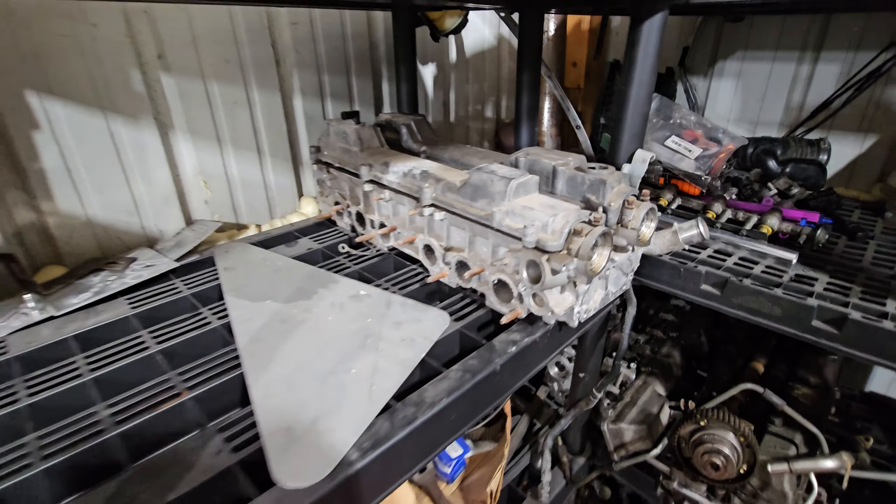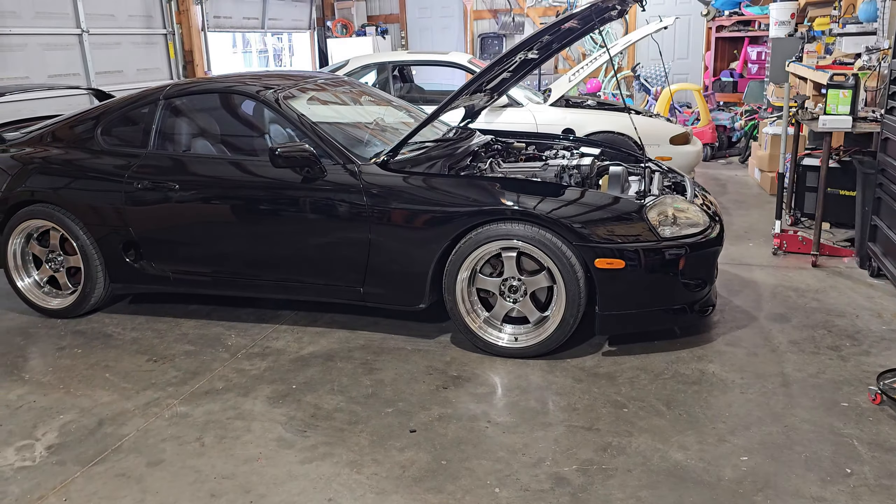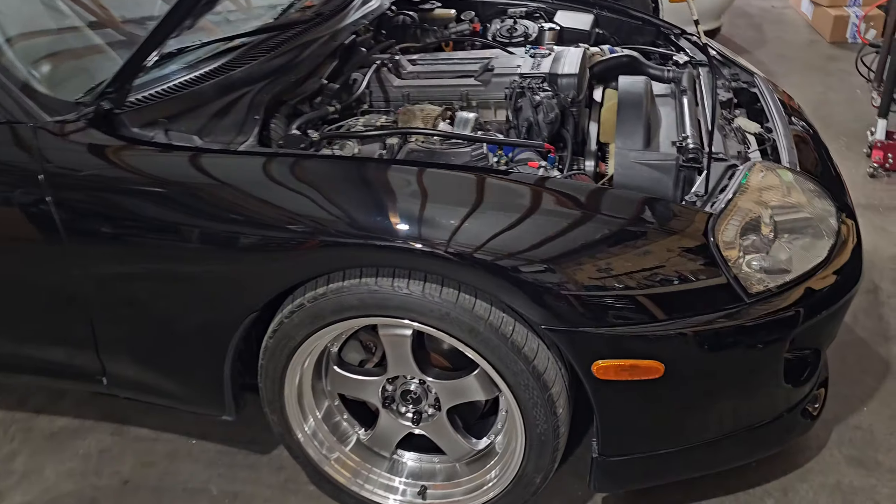When it gets a little bit warmer I'm going to disassemble this head, take all the hardware out of it, pressure wash it — it's an aluminum head so not a big deal — and deep clean everything so I can get it as beautiful as the cylinder head on the 240. I'm going to clean up the valves, wire-wheel the bottoms since they're a little rusty, and knock them out since we're putting new springs in. I'm going to order a full gasket kit from my go-to supplier, do all the valve stem seals, and we've got some GTE covers going on. It's going to be one pretty engine when we're finished.